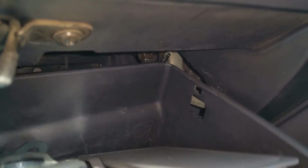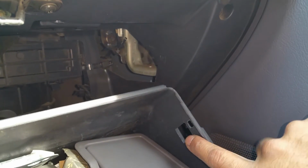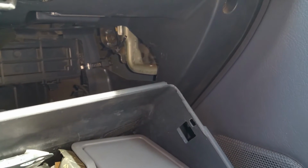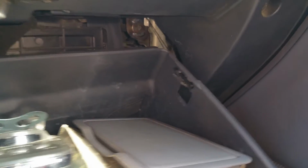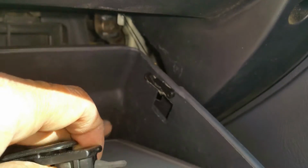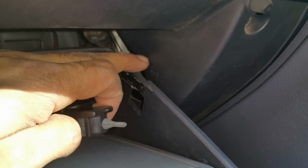And once that is through, and it's holding the glove compartment in place, we'll slide in these two tabs. This is a little bit more difficult part. It takes a few seconds, but you need both hands for that. Okay, I got that through the hole now. The thing to do now is to put these stoppers in. And so the way we do that is you push this up because you want this hole to be past the backside of the rubber mold, the rubber behind the plastic mold that's going to hold this in place.